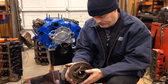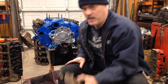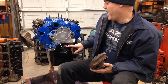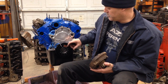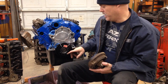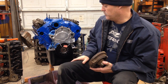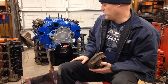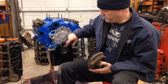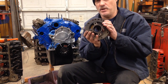There's a real easy way to fix this problem, and that is with this little baby right here. This is an aftermarket balancer and it is a 50-ounce. What's cool about it is you can also make it a 28-ounce, because the weight in the back of the balancer that offsets this is actually a billet block that bolts into the back of the balancer. You can put either a 28-ounce weight or unbolt that and put a 50-ounce weight in it. This one has the 50-ounce weight in it. And when you get the motor balanced at the balance shop, they can weld material onto that weight or shave it after they bolt it into the harmonic dampener. So this is a later model 50-ounce balancer — if you're running the early pulley setup, this alone is not going to work.